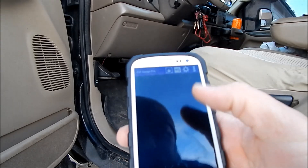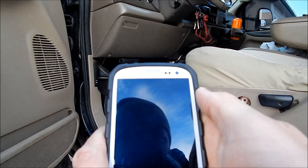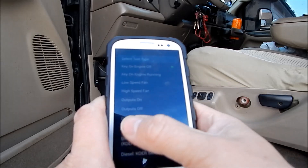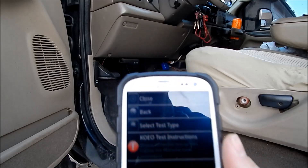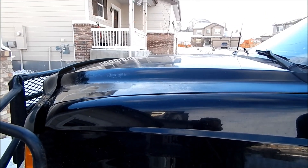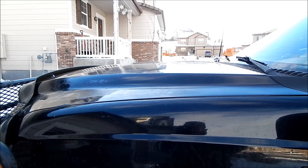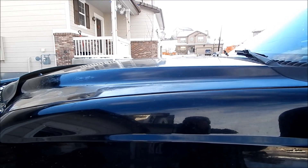Let's try this again. So from this menu, after you've completed the first thing I showed you, you can go to the three dots, OBD menu, self test, and right here — diesel injector buzz, key on, engine off. Click it again. Here it goes. And that's it. That's how you can do an injector buzz test for under $15.